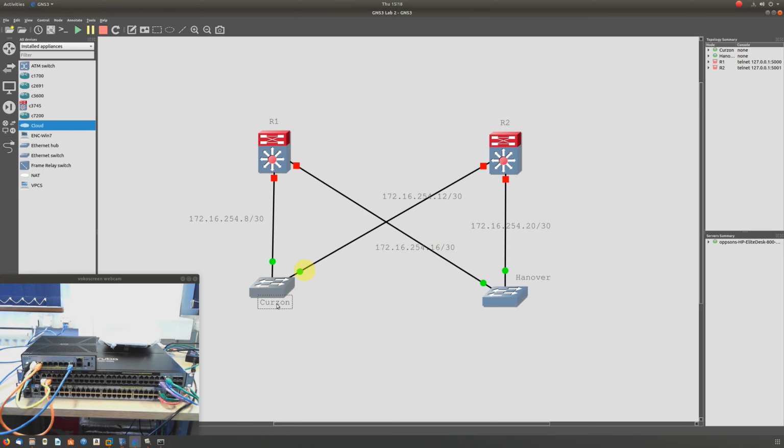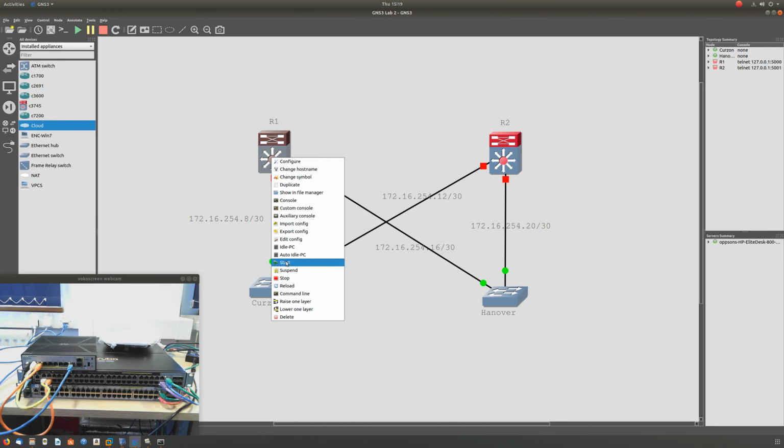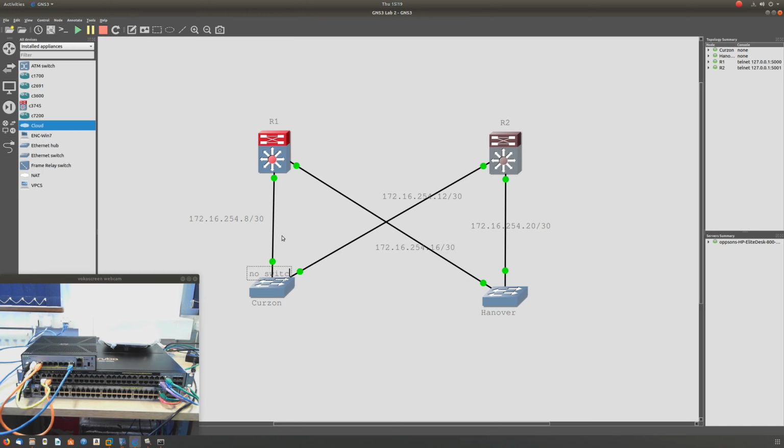Okay, now we need to establish connectivity between the core routers or switches and the access switches. Why don't we create the interlink between the core switches? I'm going to find out if that's necessary, but perhaps we can leave that for another time. Let's start here. Now, in Cisco, to make this interface a routed interface so you can give it an IP address, you go to that interface and under the interface, you do no switchport. That makes it a layer 3 interface, this one here, and that one there.